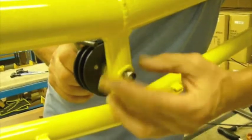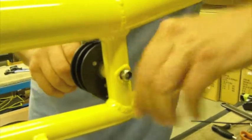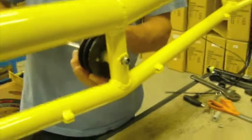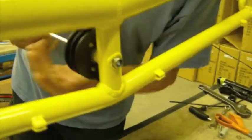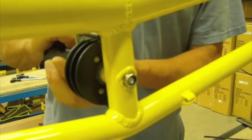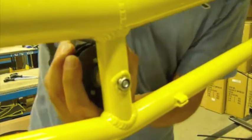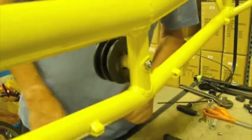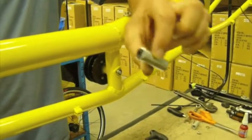We'll just put that on there. You shouldn't even have to hold that tight — it'll self-lock, kind of like a star nut. Now watch how much I'm going to pull that down. This is important: you want to suck that baby down until you are coming out on the other end with that nylock. And that's it — we have now fixed the Xtreme idler after you've broken off your original welded-on stub.